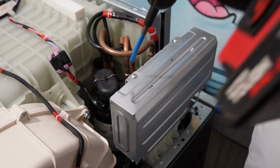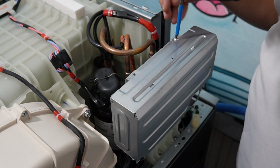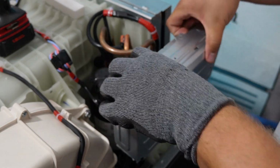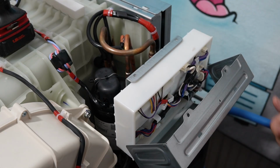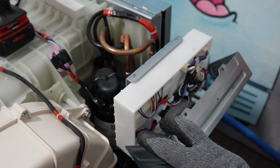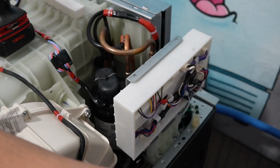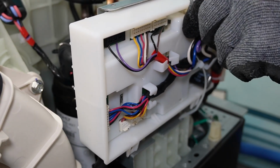Now, I didn't film it, but if the valve replacement didn't solve the issue, it's possible that there's a board or pressure switch issue. This is a very new machine, and we haven't really done a lot of testing on this, but if one of those situations was the case, you may need to go into the main board and test C&D 12 for voltage, but due to how advanced that is, I'm not going to do that in this particular video. So let's go back to the rest of the machine and how to reinstall and put it back together.